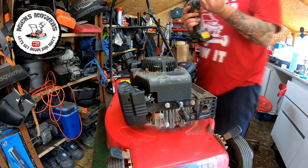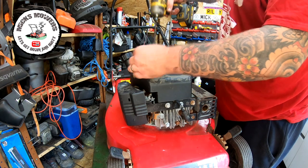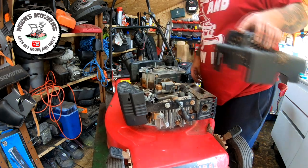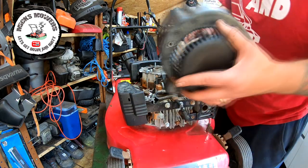Let's undo these — 10mm bolts, undo those, take them off. The pull cord comes off. It's a bit mucky up in there, a bit of a blow needed in here because there's bits and pieces everywhere, so I'll give it a spray of WD-40 in a minute and I'll just air-compress all that off.